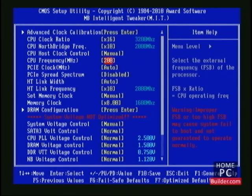Begin by raising the reference clock to 275 MHz. This value is probably greater than most motherboards can handle, and more than you will need. When we did that, the CPU, HT-Link, CPU-NB, and memory speeds went way up.